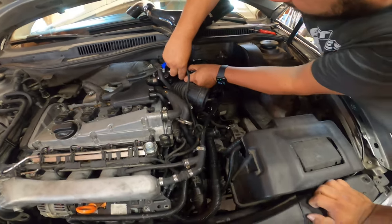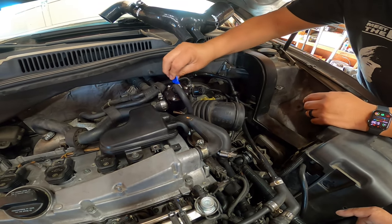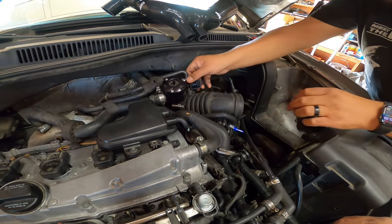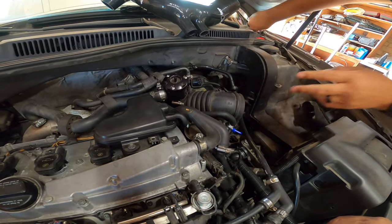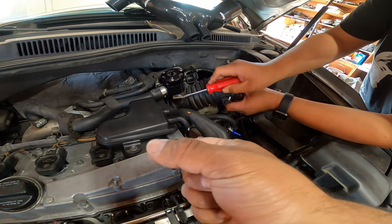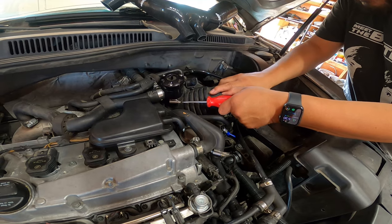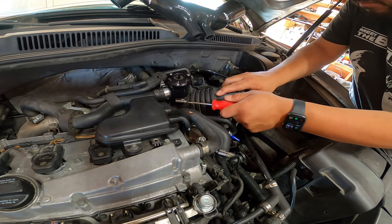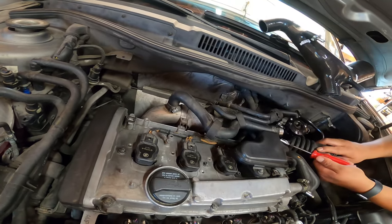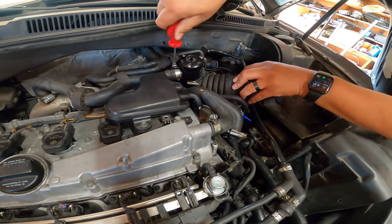There's actually a clip for half of the turbo inlet pipe to come out. There's a clip halfway through that you have to pull out, so the turbo inlet pipe comes out. It's pretty much a retaining clip, kind of like on your intercooler and your turbo inlet — your charge pipe right here. That clip that holds the rubber portion on the lower section is like a little pull clip and you just wiggle it out. Same thing, just in a much crappier location.